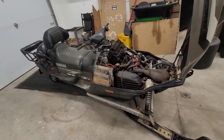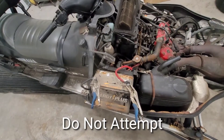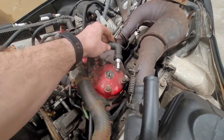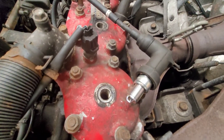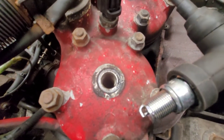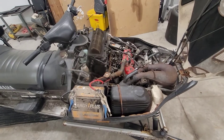It's the next day — everything has melted off. I decided to try something quick: I took the battery out of my old Subaru and tied it up to do some quick testing without having to pull it over every single time. Now we've got plenty of juice, however we don't have plenty of spark. I'm going to crank it and get the spark plug to sit on a stud so we've got a good ground. What's happening is when I release the key, it actually sparks for only one spark. So let's do another easy check — let's go to the fuses.